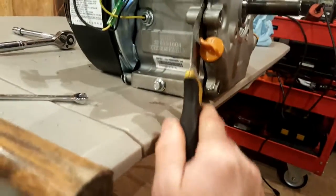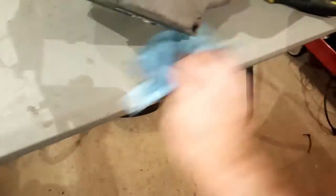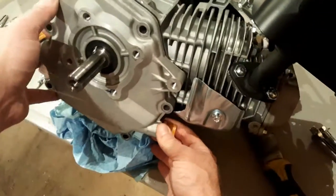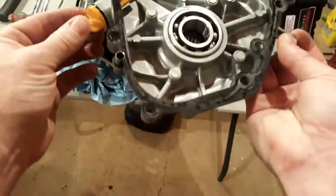These cases are cast, so they don't take a whole lot. I've got a little rag here to keep things clean. We're going to tip the motor on its side. Even though I drained the oil and let it drain for some time, you're still not going to get all the oil, so it's never a bad idea to have some shop rags laying around. I'm just going to take a look and make sure I'm not tearing this gasket, because I really want to reuse it. There we go — side cover's off, and the gasket is in really good shape, so I'm definitely going to reuse that.